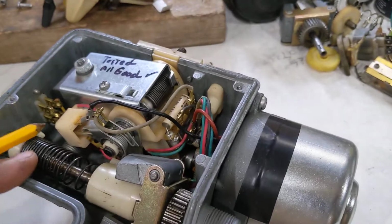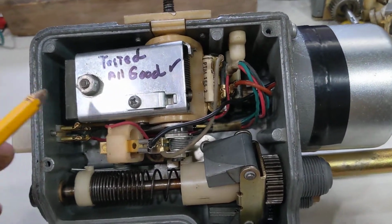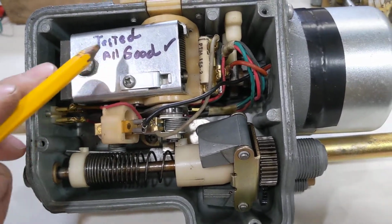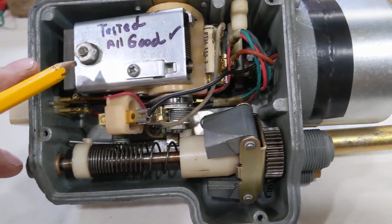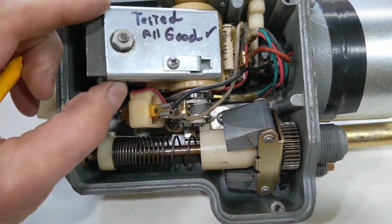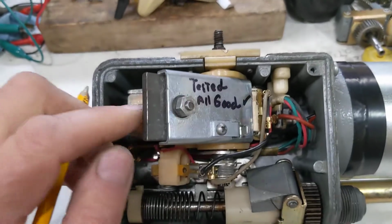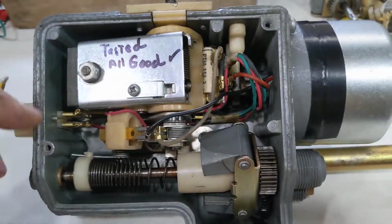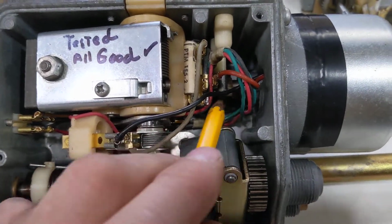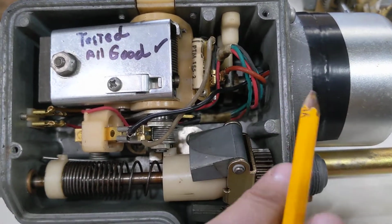Limit switches help prevent the system from being stuck at wide open throttle, and they disconnect the magnet when there's no power or the brake is applied. Disconnecting the magnet's really important, because then the throttle is no longer controlled by the movement of the magnet. You can't see it well in this image, but underneath there's a long screw. I'll show you the component, and the motor turns that screw back and forth. It's called the Bi-Directional Motor.